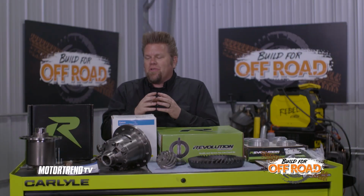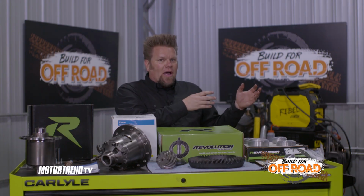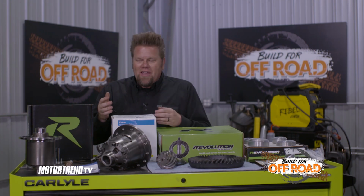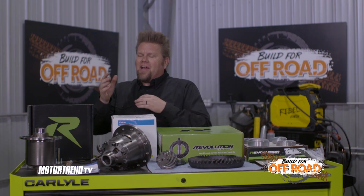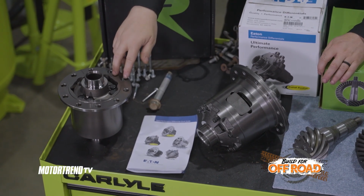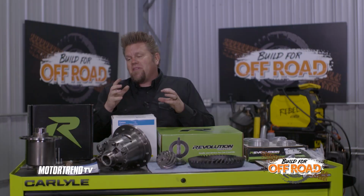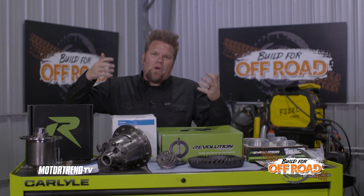Now, whether you want to install a limited slip or a posi or a selectable locker or a mechanical locker, it all boils down to the application of the vehicle. If this vehicle was going to spend a lot of time on the street and less time off-road, and I just wanted some additional traction when I'm in the dirt, well then maybe I would go ahead and choose the Eaton TrueTrac. This is a helical style posi type differential that basically senses wheel spin and then will engage both wheels to give us traction when we're off-road.